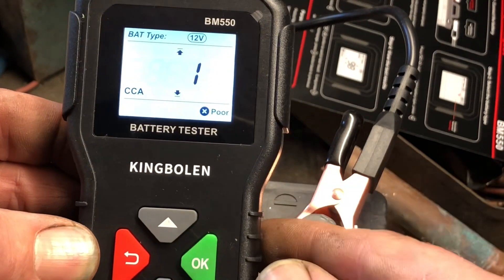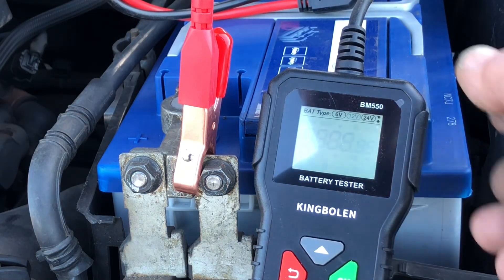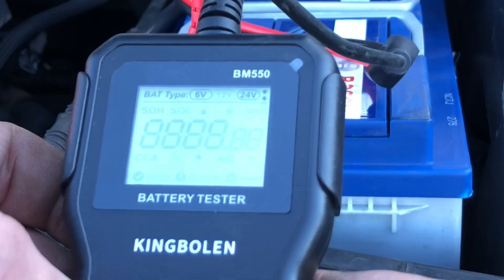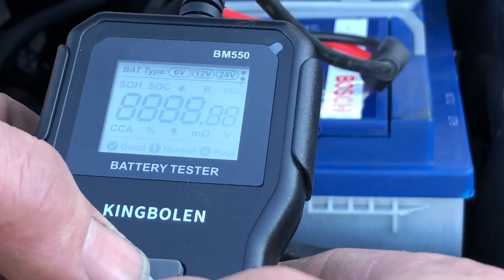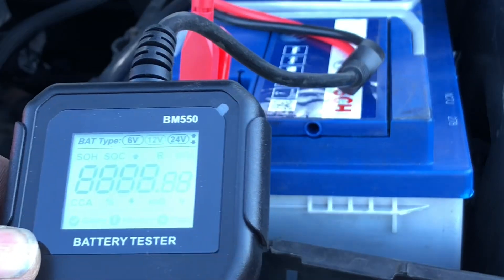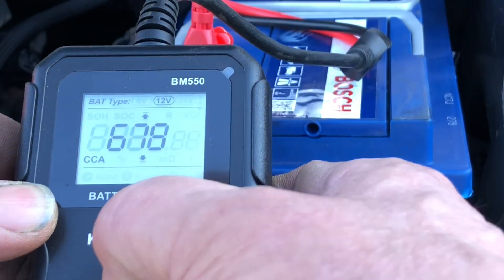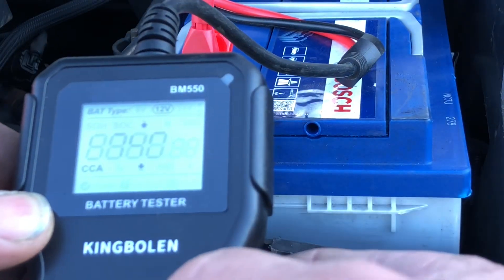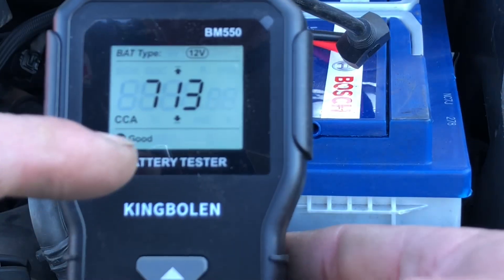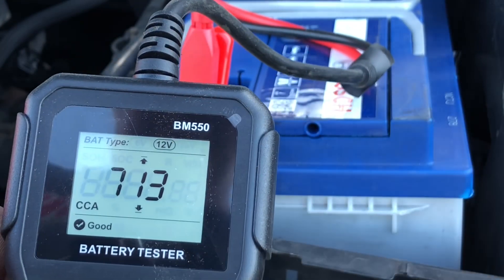Right, I think let's go and test it on my own car. So we'll just stick that on there — boom, straight away we've got some things. It's self-detecting — self-detecting and saying that it's a 12-volt battery. You can change the voltage with the up and down buttons, so we've chosen 12-volt and press OK. We know this is a 740 cold cranking amp battery because it's a big diesel. And OK — this better turn out as 713, and it says it's a good battery. Well, there we go. I didn't expect anything less. This seems to do what it says on the tin.